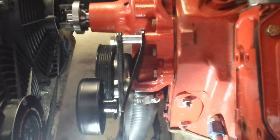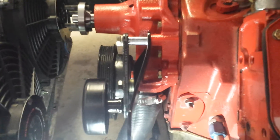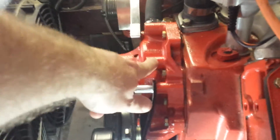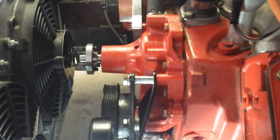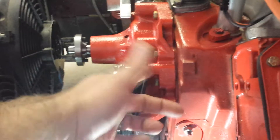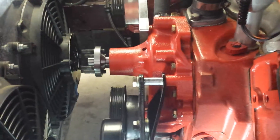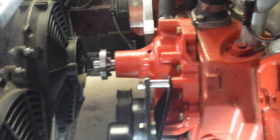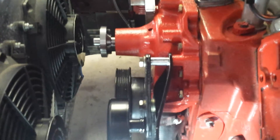What you're going to have to do to get this to work — my configuration may not work on your engine for the simple fact that you have all these different water pumps: aluminum water pumps, cast iron water pumps, some with tall bosses, some with short bosses. I've got three different water pumps for this engine and all three are different. So every time I swap one out, I have to re-shim everything to get it to work.